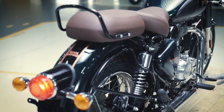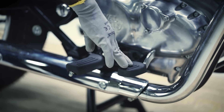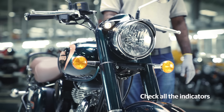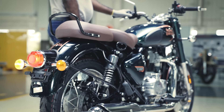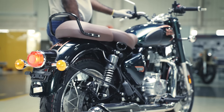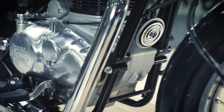Next, press the rear brake and check if the tail lamp is glowing as you do it. Turn on the indicator switch on the left side and check if the indicator bulbs on the front and rear are working. Repeat the action for the right side as well. Press the horn button to check if it's working fine.